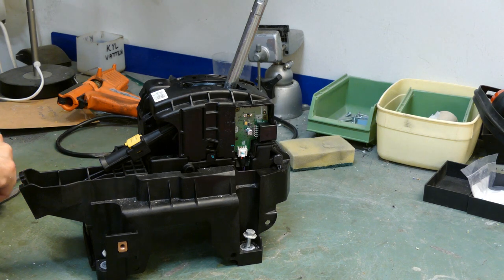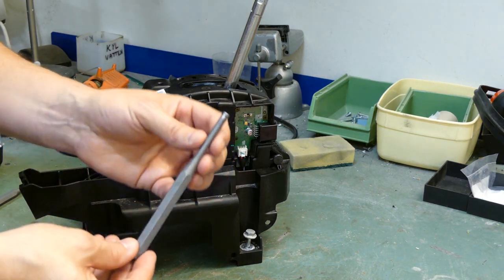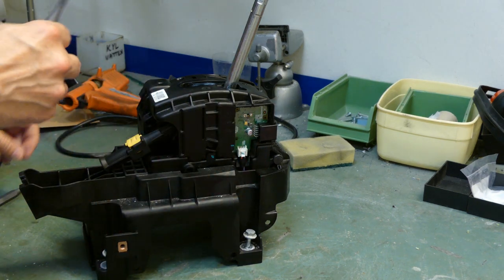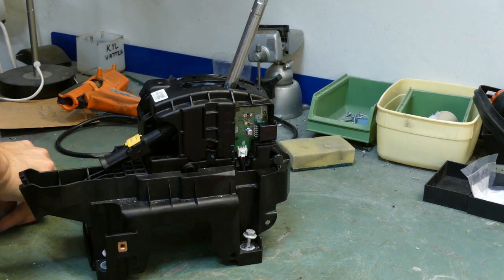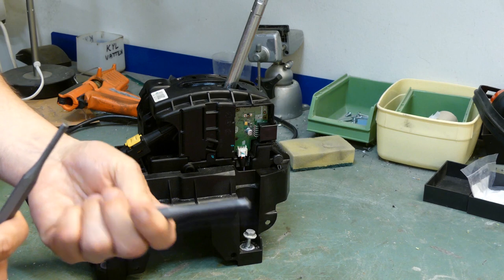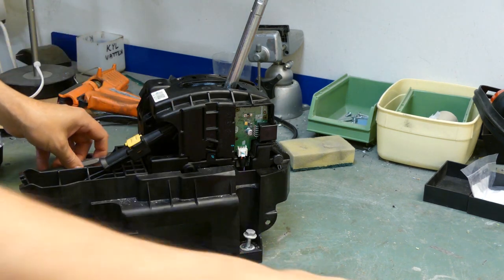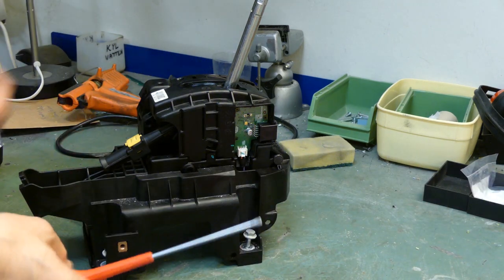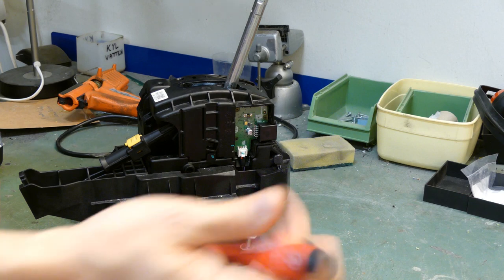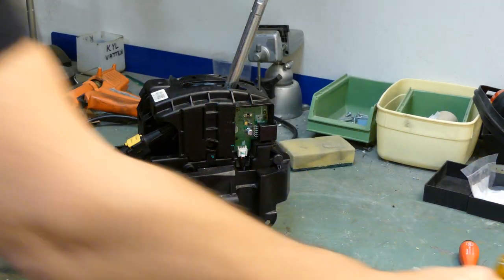And to get them out, you need this, it's a pin puncher tool. 6 millimeter, and then I have a 5 millimeter to pin punch out the other pin later on. And you might need something else for the last millimeters, maybe a worn out screwdriver or something. And of course, you need a good hammer.